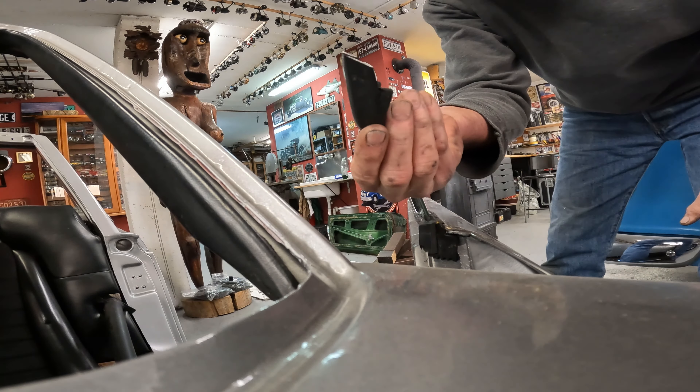I know this is kind of hard to see right here, but you see there are little lines up in here — this is that little attention to detail. I'm going to polish these out right now, so when you put the new seal in there, it'll be almost impossible to see. That little line is where the old seal dirt collected up in there. You can use all the Windex in the world, but it won't get it out. The way I do this is I got myself some really, really fine polishing paste or chalk, and then you can get that little line off of there. Nothing wrong with using a polisher to do this. Then get yourself a little bit of brake cleaner, put it on here, and wipe it off. Clean — you've got super clean glass like the day it rolled out of the factory.